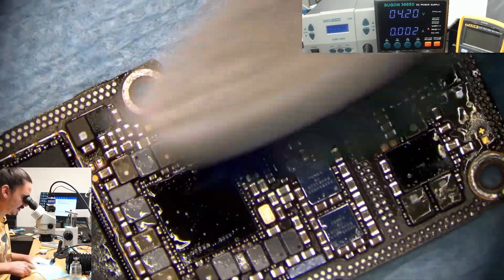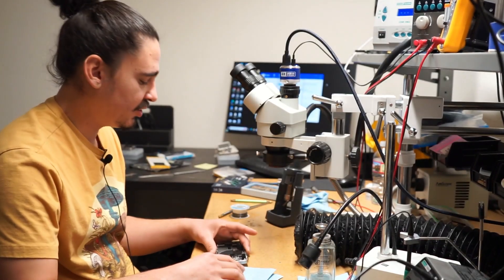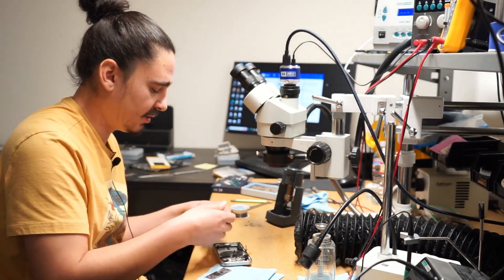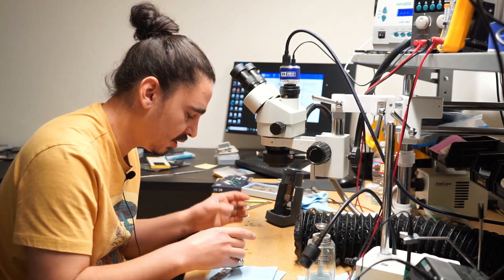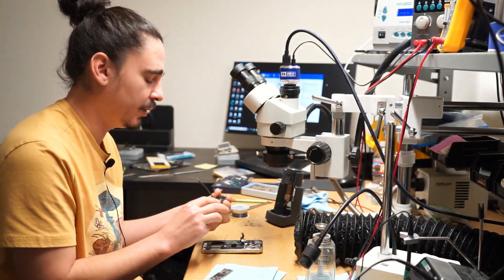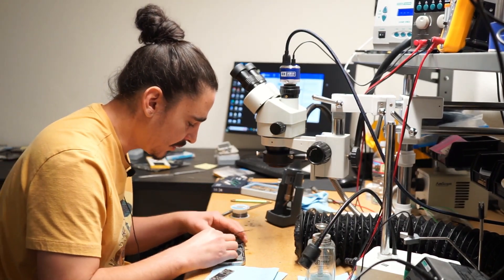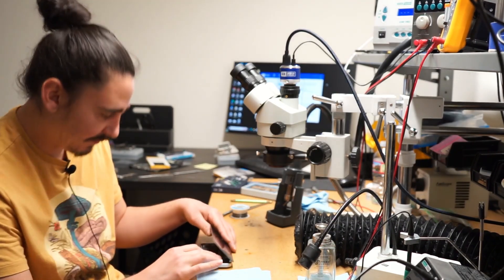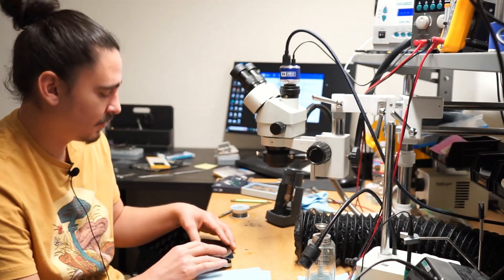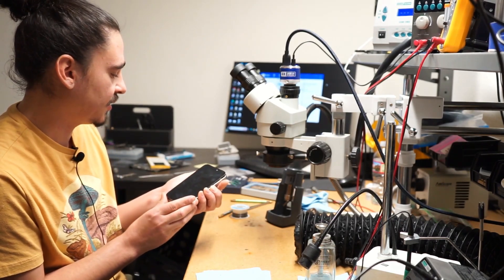This is the first time I've actually tested this solution, so I don't know if I'll run into any unexpected problems. Before putting it in the jig, I can put it back into the original housing to see if it will turn on. I expect it should turn on top-board only but will probably give me a three-minute reboot because the wireless coil connects to the bottom motherboard. The top board is sitting on top of the bottom board for proper height but is not connected to it.